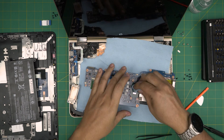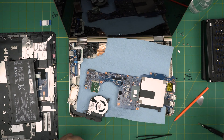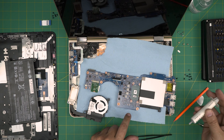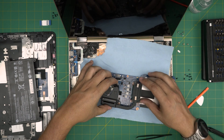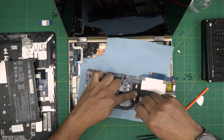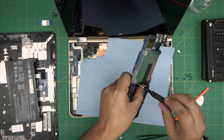Use a dry part of the towel for a second pass to make sure there's no fiber or dust on top. Then put one drop of thermal paste in the middle of the main die, and one drop on the second die — the PCH chip. Now place the heat sink straight over, hold it with one finger, and cross-screw them — one screw on this side, then one on the opposite side — so the thermal paste spreads evenly over the CPU.